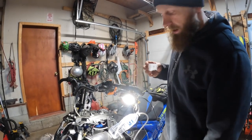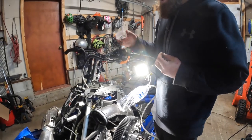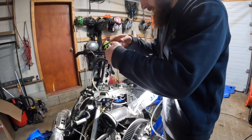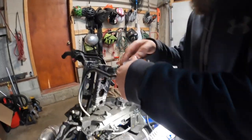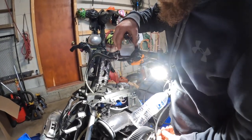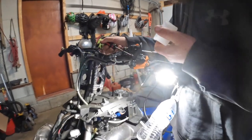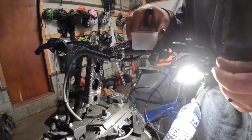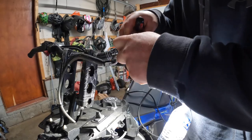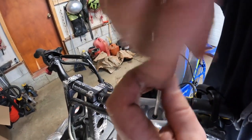We were in a hurry and wanted to get back on the trail riding, so we just grabbed one of the stock setups in the meanwhile. I'll probably order one - TKI makes a protector for it and Ski-Doo does too, so we'll get one of those in the future because this is probably going to happen again, especially riding in the trees. Essentially just put it on there - it goes on only one way. Make sure your rubber gaskets are on there, take your old one out, there's a little hole it pops into, then put your screw in and get it all mounted up.